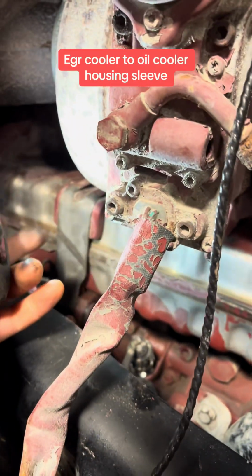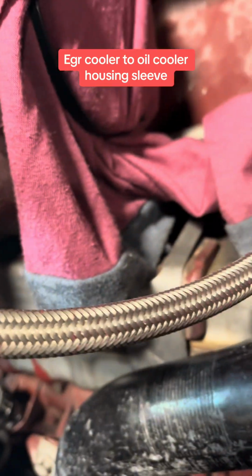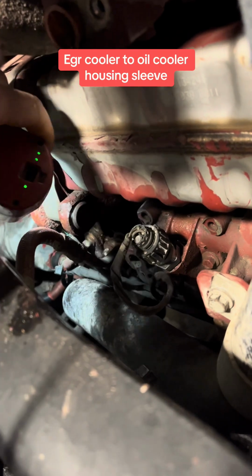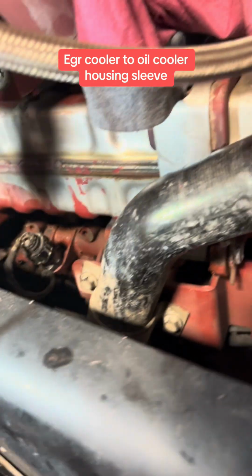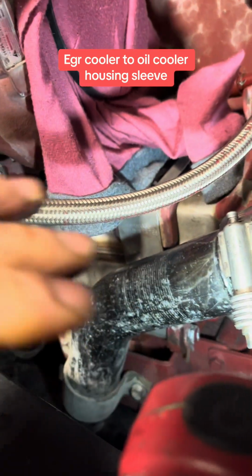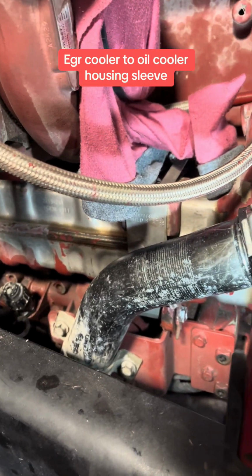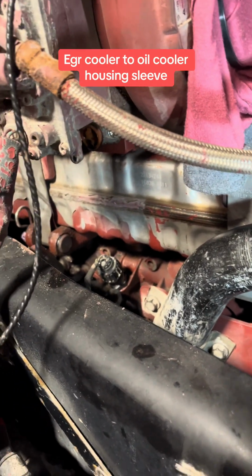Then I take off the straps, right? Obviously, take off the strap, which is over there. Then what I would do is pull it back to the frame where I have enough room that I can actually take out this bracket and this bracket. Then I'd pull the brackets out, kind of curve them out. I screw around, curve them out, right? And then I have enough room where I can actually pass the cooler in between the turbo and the frame and wobble it out.